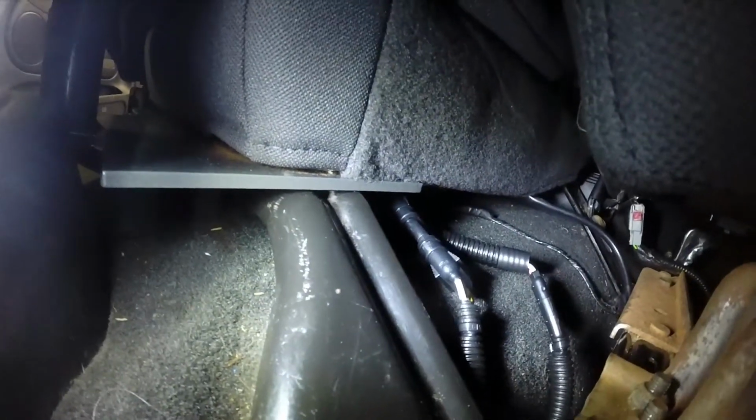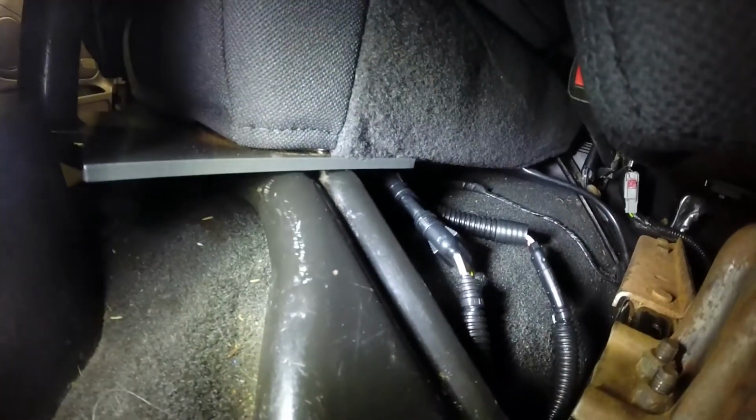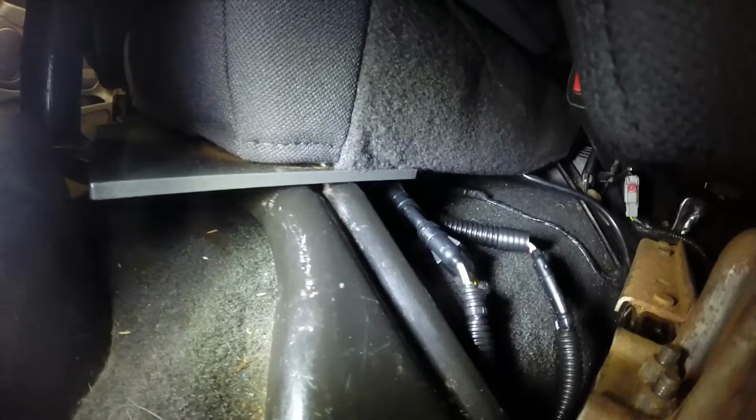I have that 4-pin, basically a trailer connector, wired to the shifter, so you can basically unplug the shifter and take it out without having to unwire anything. The other plug back there, the little 2-way, is for the overdrive and lockup switches. And then I've got one connector hidden underneath the seat for the cigarette lighter that's in this center console.